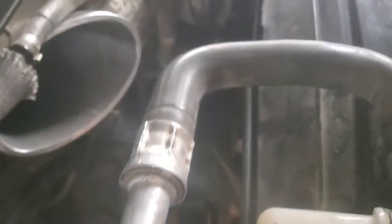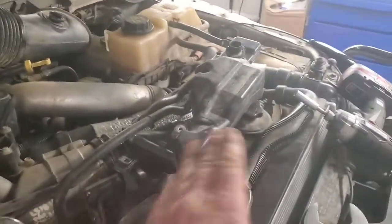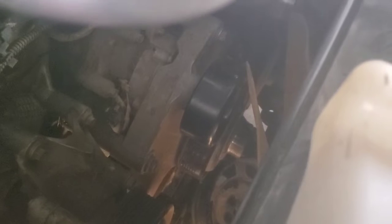Pretty minimal stuff to take apart overall. The fan will lean way back in there so you should be able to get the harmonic balancer out up this way if needed. The only things taken apart were the air intake and rolling that over. Now all we have to do is clean up the areas where the belt ran, because there are pieces of belt stuck on a lot of these pulleys. Get all that cleaned up and the grooves cleared out so we don't have any issues with the new belt going on.